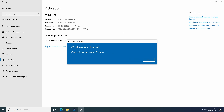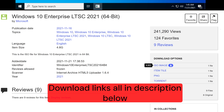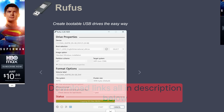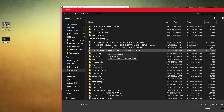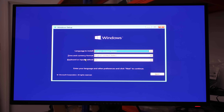If you don't know how to get the install going, I'll put the links for the image files in the description below, where you just download the particular image you want to install, whether it's Windows 10 Enterprise, Windows 11 Home, or Pro. Then you get a program called Rufus, as well as an 8 gigabyte or bigger USB flash drive, plug that into another PC, get Rufus, load the image file in, and go through the steps.